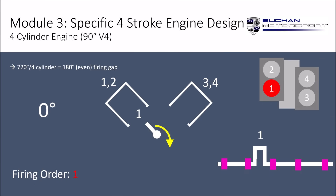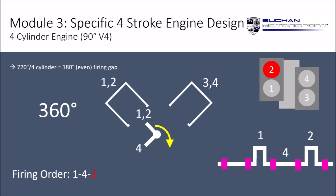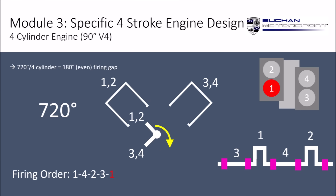At the bottom right corner we see the crankshaft with 5 bearings. At 0 degrees we start with an ignition in cylinder 1. Because it's a 4-stroke engine, we need 720 degrees for 4 strokes, and since we have 4 cylinders, we divide 720 degrees by 4 — so 180 degrees later we should have the next ignition. We now want to fire a cylinder on bank 2, and have 2 possibilities. In order to spread load evenly across the engine, we decide to fire cylinder 4 next. Another 180 degrees later we fire a cylinder on bank 1 again, and the only one available is cylinder 2, because cylinder 1 just fired 360 degrees ago. And 180 degrees later we fire the remaining cylinder 3. So a possible firing order for this L-shaped crankshaft firing in a cross pattern is 1, 4, 2, 3.